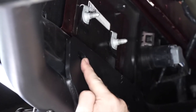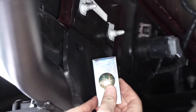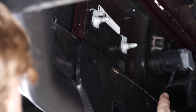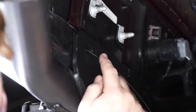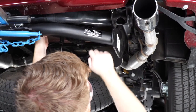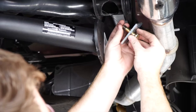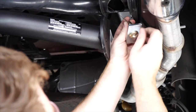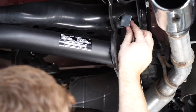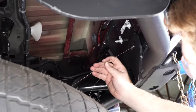For our two attachment holes behind the hitch, we're going to need to bring our carriage bolt and large spacer block into position. To do that, we'll take our fish wire that is included with our kit and push it into the holes, then push it to the outside of the vehicle. It'll follow this tube until it comes out of our access hole. Then we'll attach our carriage bolt and spacer block — throw the block in first — and repeat on the driver's side.